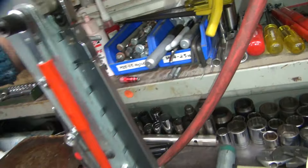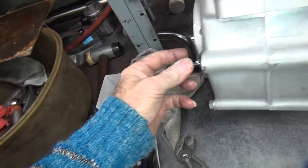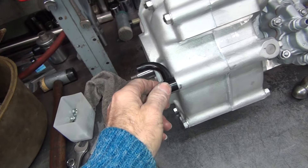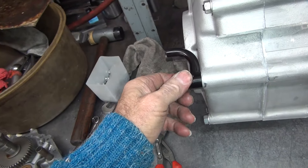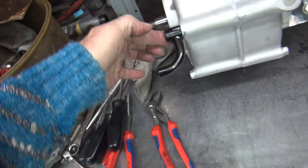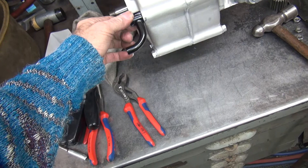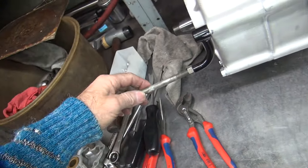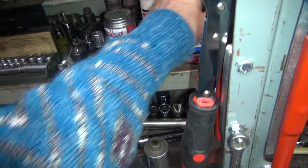We're going to leave that open for him so he'll know. When you have these problems, don't do stupid stuff. So that has to be left open. Now this here we had to undo because we had to get some room over here for the oil pump. This is our breather for our belt drive — our chain drive. And that's what this thing does, puts the oil in the system. Right now this is just breathing fluid. Your engine breather blows right inside your primary. So usually what I do on these is I used to just cut these off and put a tube right here, put a hose on it, rotate this down, and I'm going to grind a little notch in here so we can work on the pin. The tube would go straight down and go around the back of the bike on the right side, away from the chain. The last couple I did I took this with a torch, heated it up, took a big bolt, jammed it in there, and just rotated it around until it was straight. Then you have that much length to play with — cut off what you don't want and you're good to go. Here's a 3-inch bolt, like that — that thing just comes around with a little heat on it.